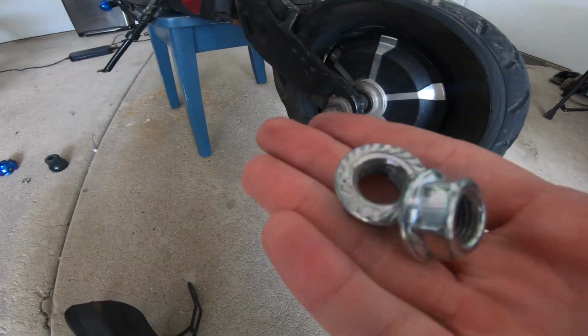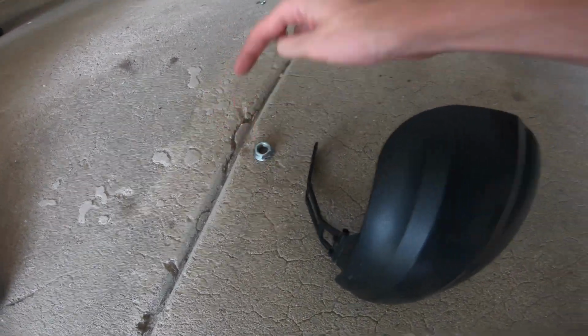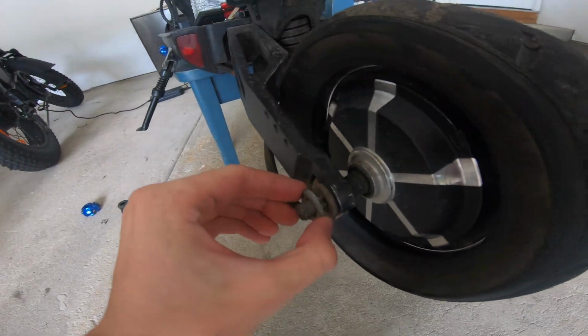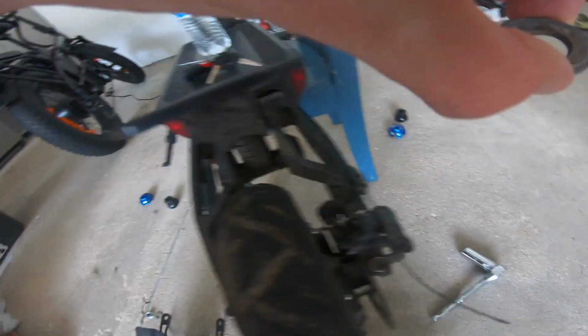Once you take off the main bolts and the fender, if yours has one, I like to organize my pieces like this, just in case so I won't mix up the order of everything when putting it back. So the 2 bolts go on the outside, and all these little screws are gonna go in here. Next, if your scooter has one of these rings, you're just gonna wanna take them out. You're gonna wanna put them in the exact order, right here, ring by ring.